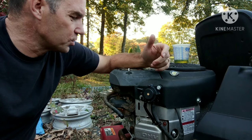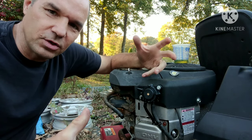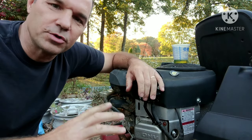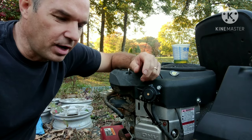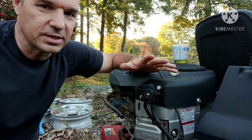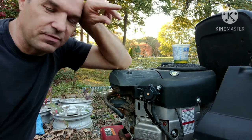So if you've got a mower — this is a 26 horsepower — it needs a bunch of fuel. When this thing is cutting grass and really digging in, it's wanting a lot of fuel. Getting half the fuel is going to cause surging at power. When you're powering up and the mower's at full tilt — this is a 52-inch deck, this thing's working hard — you've got half the fuel coming through. You're going to have surging, you're going to have problems, and you're going to be fighting that issue.